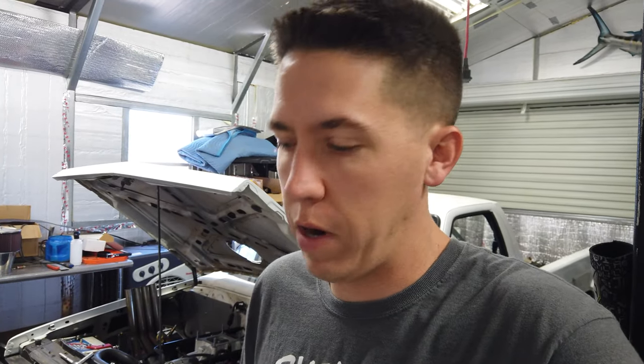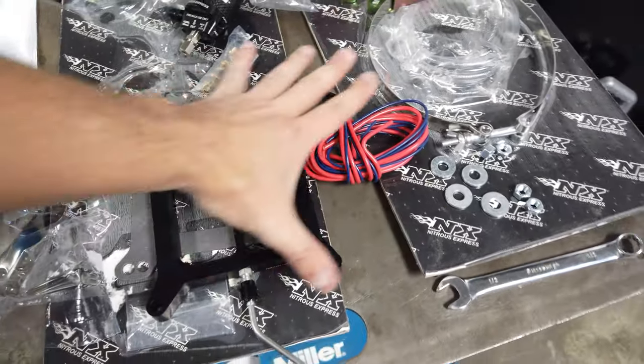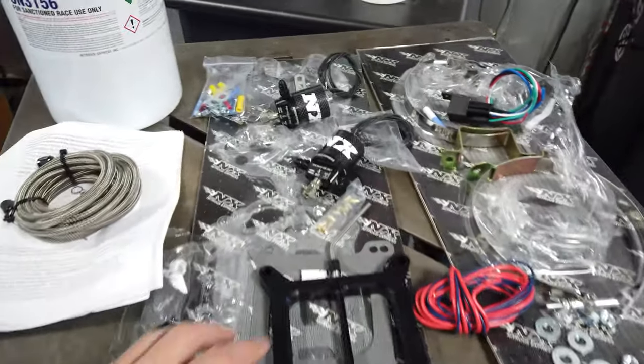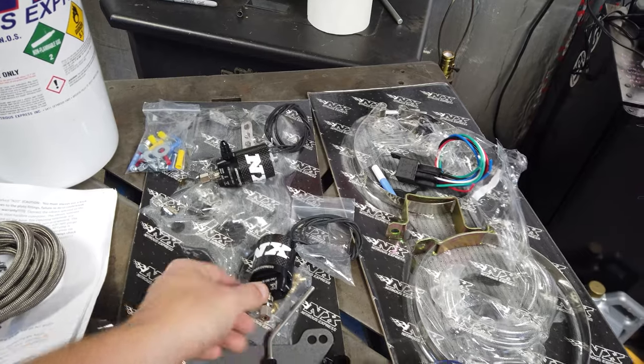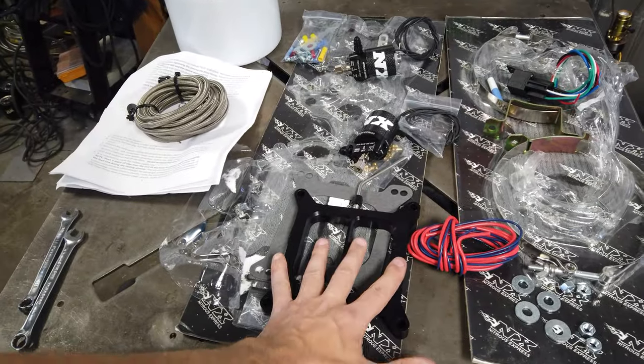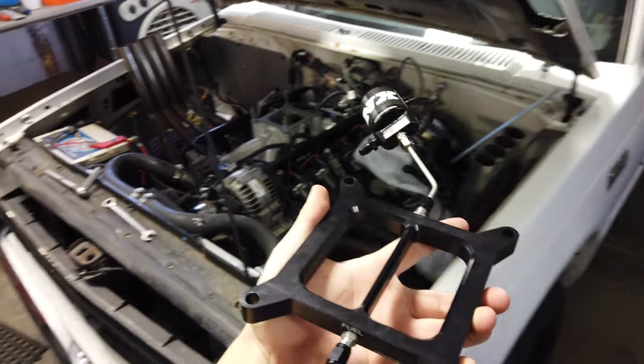To make sure we don't overshoot what I have availability for fuel and tuning and all that stuff — plus it's a burnout, I don't think we need a ton. But another 50 or 100 horsepower is going to do crazy things. Remember, this thing made right at 400 horsepower on the dyno, so with another 100 on it you're talking possibly right around 500 out of a 4.8 — that's pretty rowdy. So I'm going to get these set in here and get these fittings mounted on there as well. We've got these lines kind of positioned where we want — we're actually going to go off to the side on both of these to give us some clearance to the alternator. It's pretty much where we need them, and then there's this cool little crush fitting here that screws into the bottom. I don't have a purge, so we'll end up blocking those off.